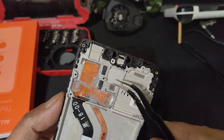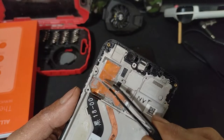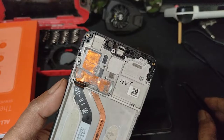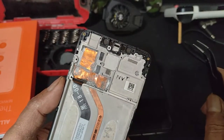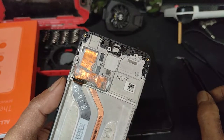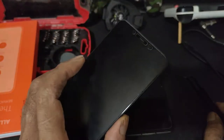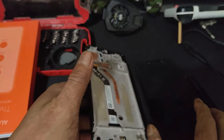And to cool down the CPU further, I add this piece of copper sheet. It's not too thick and not too thin, just enough, maybe 0.2 mm, somewhere there. Too thin, not so good. Too thick, your motherboard will be a bit too high. 0.2 is the best. The heat transfer is better on copper compared to this alloy body. All right, I will transfer the motherboard over here and see whether the NVT will work. Let's see.